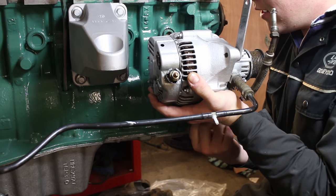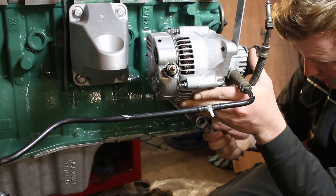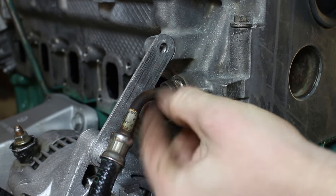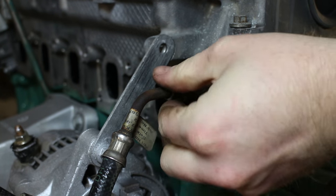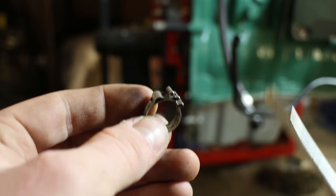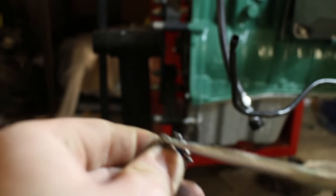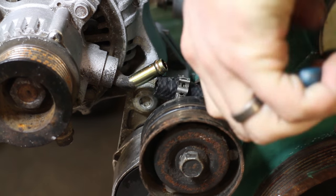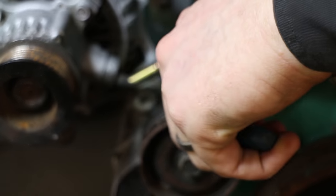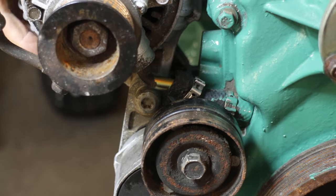First though I need to bolt up the alternator and vacuum pump, as you have more access to do this when it's off the vehicle. This is secured with three bolts. The vacuum pump oil feed is then reinstalled, and the drain pipe too — that needs reconnecting. It's secured with a hose clip that simply squeezes together to lock it. To remove the clip, insert a screwdriver into the mechanism lightly prising it apart and it should spring open. Then using some grips we can locate the hose onto the outlet from the vacuum pump — if it has a kink in it like this, it's not fitted correctly.